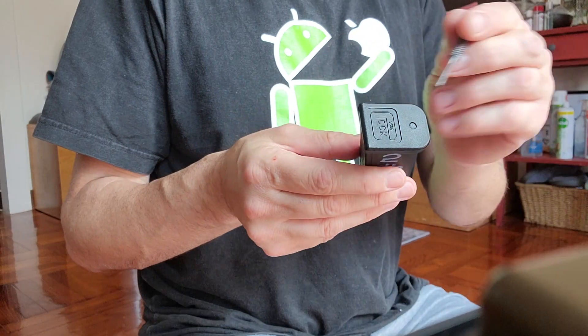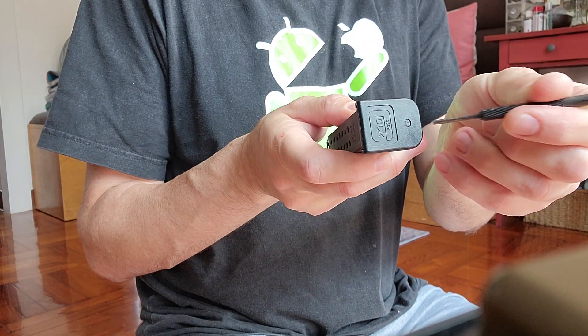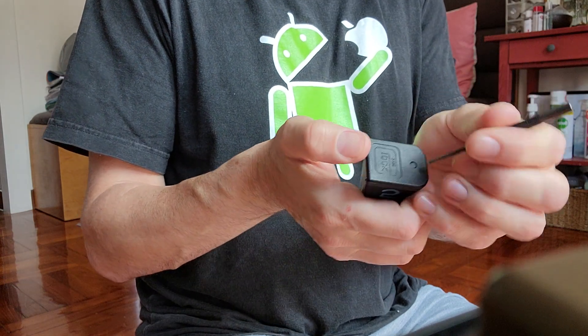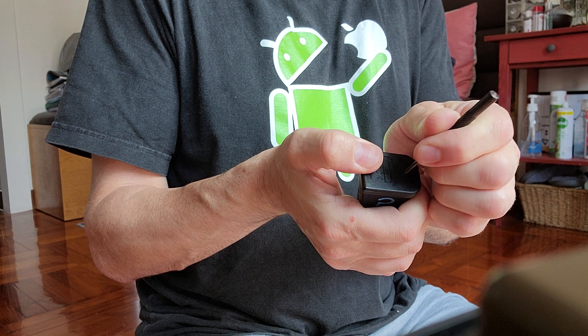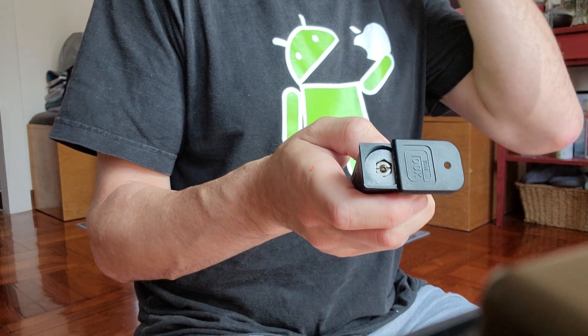The fill valve is located under the base plate. To release the base plate you have to push in this pin here, so use a punch or something. Gently depress the pin — don't depress it too hard. Slide the base plate forward; it will stop there and be captured.